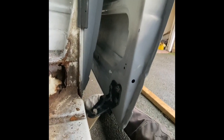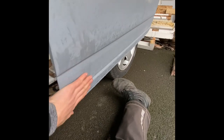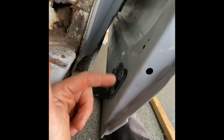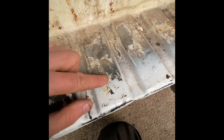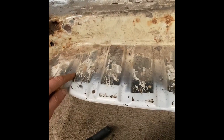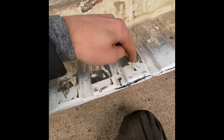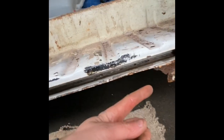It's a mammoth job and it's the last major body work job I need to do on this van. The door's done — that was covered in one of my previous videos, which you can check out: how I went about replacing the exterior panel and reconstructing the full length of the interior as well. First thing to do: I'm going to grind all of this back with a flap disc to reveal the spot welds. There are going to be roughly about 20 spot welds along here.